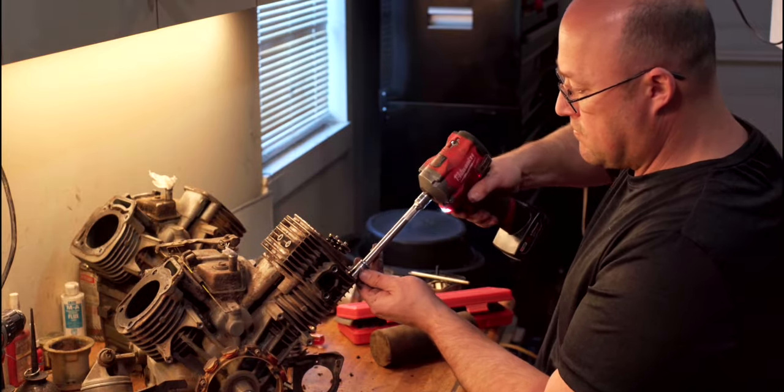Heartbreaker. All right, here's the bore on the 16. It's smooth and it still has etching on it. Definitely got some carbon built up on that side. Definitely got some oil seepage on that one. You can see it. Everything's going dead on me when you need it.